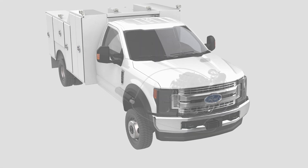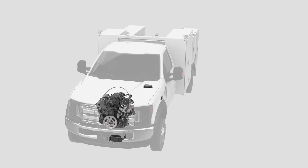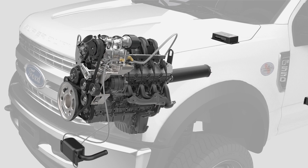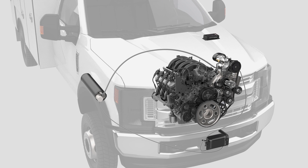This is how the Underhood 70 and 150 systems work. The compressor is belt-driven via a crank pulley that is added onto the vehicle's crankshaft. When the operator turns the system on, the 12-volt clutch on the compressor engages and the throttle control increases engine speed. Once the system has built up to operating pressure, the engine speed returns to base system idle and the system is ready to use.